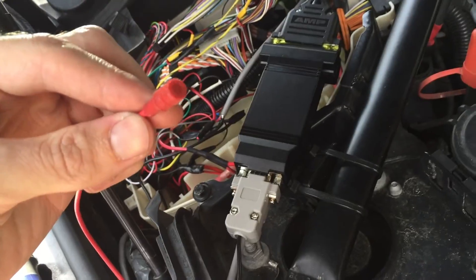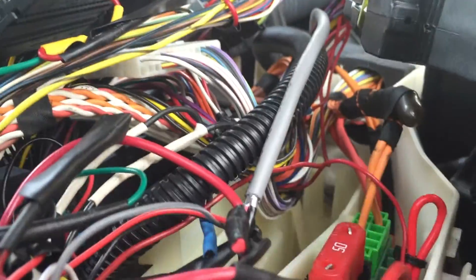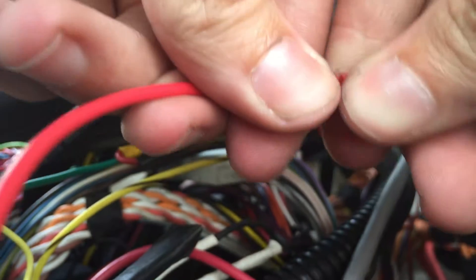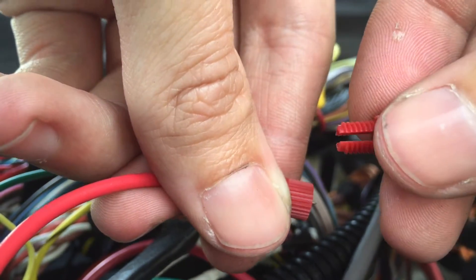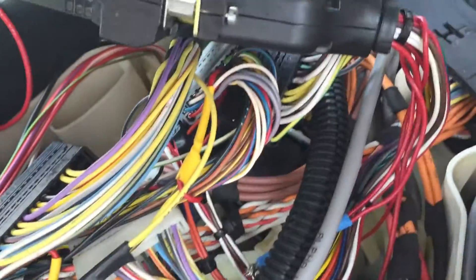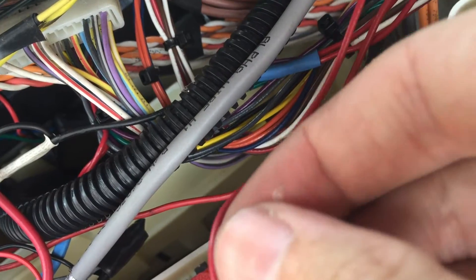Find your red power wire. What you're gonna want to do is unscrew the base of that. You're gonna slide your JB4 power wire in between there. It should be this wire coming right off the 12-volt connection here. Go ahead and put that in there, then go back to the connect kit on the other end and screw it in.